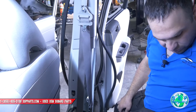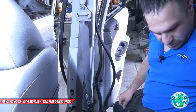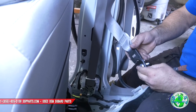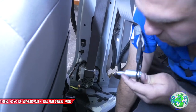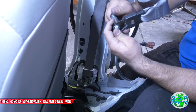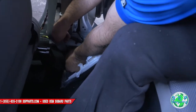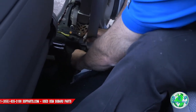Do not just put the gun and zap it in — you will ruin the threads and have a lot of issues. The bolt goes in first, then the big spacer, then one of these retaining pieces to hold it all together so it doesn't fall out. If you buy them used and they don't come with the bolt, use your old bolt. This is a pain to put in by hand, but you have to put everything in by hand first. I've stripped this bottom bolt a few times just being in a hurry — it's not fun having to re-tap it.